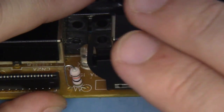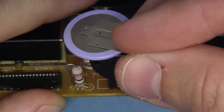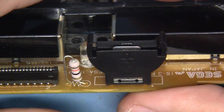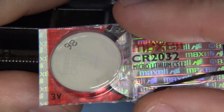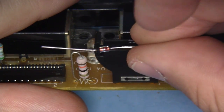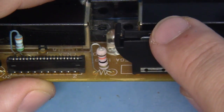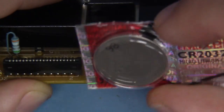Now we have a convenient battery holder installed here. The stock battery is an ML2032 — a rechargeable unit, but these are pretty expensive and have poor capacity even when full. I've seen a lot of people use LIR2032s, but these are the wrong voltage. Not only are they risky when fresh, but they have even worse life when recharged by the Dreamcast's much lower voltage. What I recommend is a CR2032. We can use these by first blocking the recharge path — basically right in here — with just a single Schottky diode. Pay attention to the video description as I'll have links for the diodes I like to use, plus these vertical battery coin cell holders. When the battery dies, it's cents on the dollar to replace.